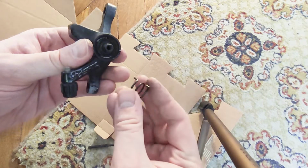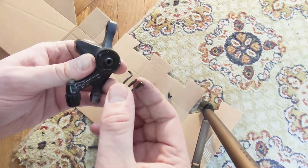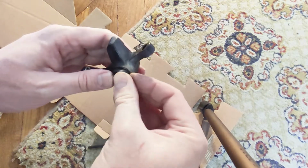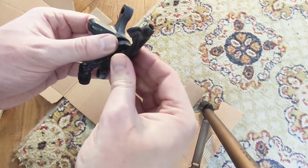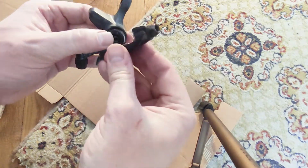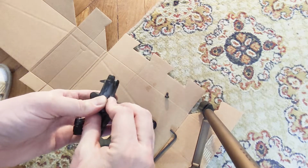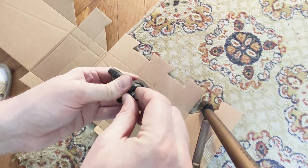Then you will need to assemble everything back, meaning the coil. You place the coil first. The part which is more straight goes into the hole. In my case it is this one, like this. Then you place the dust cap, like this, and then the arm. Meanwhile, be careful not to drop all the mechanism, because you might lose the bearings. And you just move it a bit so you can adjust it. Once you have it like this, you can just insert the bolt and screw it.